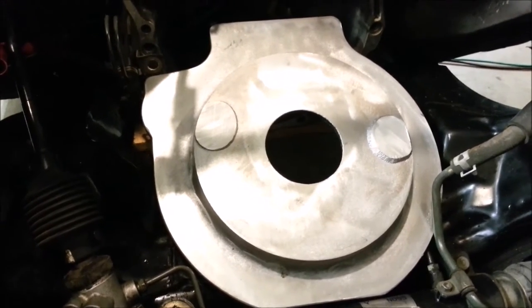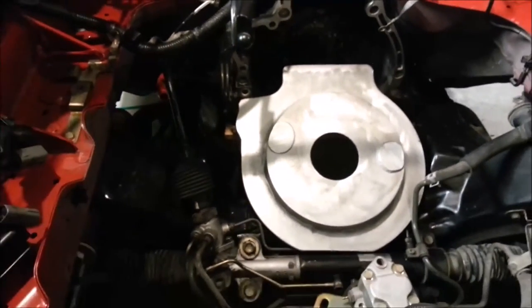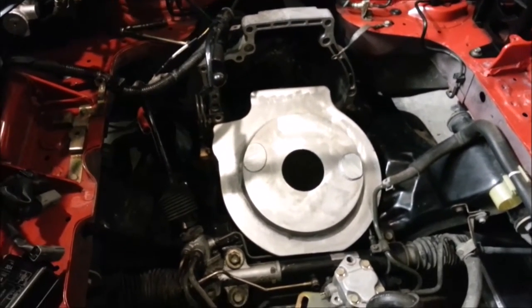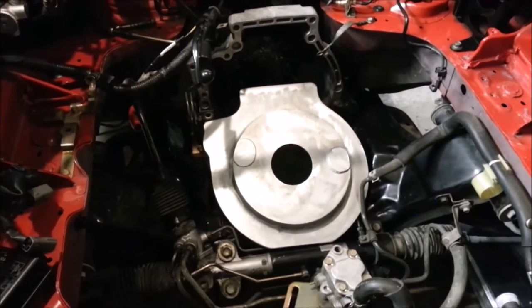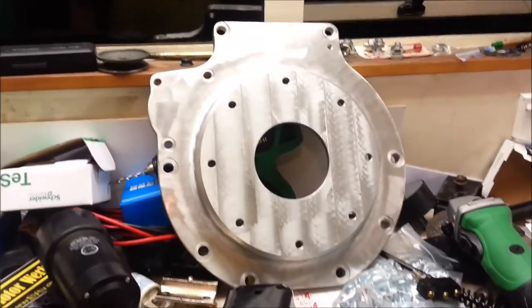On Saturday morning I finally got the old engine down to the machine shop, and he's taken the last two dimensions I need - the dowel hole positions. Got to be careful because they don't actually line up with the center of the motor. Also watch out for the magic number on this car: measuring from the engine face to the front face of the crankshaft gives exactly 15 millimeters, but you've got to subtract the 1.2mm shim that goes between the gearbox and motor, so the magic number is 13.8mm.